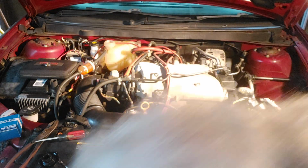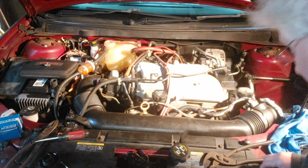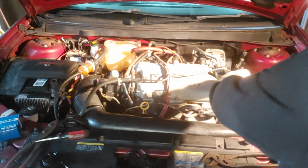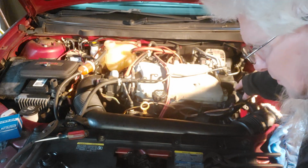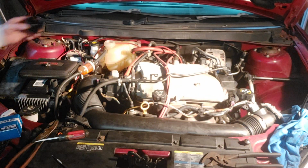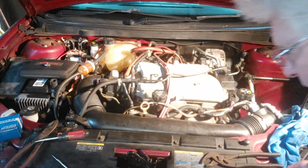This out of the way. And before I forget, swap out the cap. Two surge tank or radiator caps, both 15 PSI. We can't run a 15 and 18 together. That'll work for now. Okay. Now then, let's see what I have here.